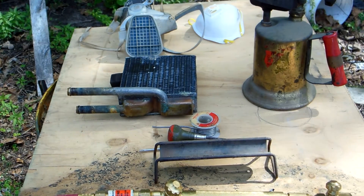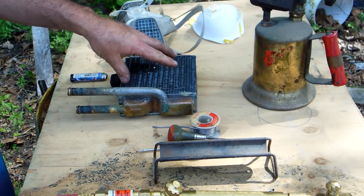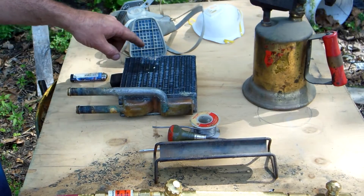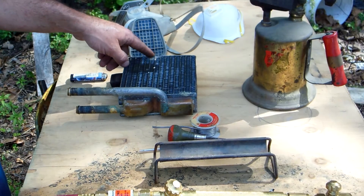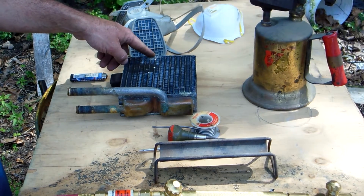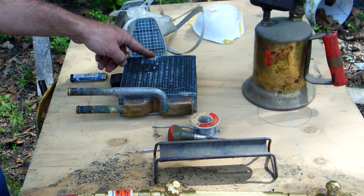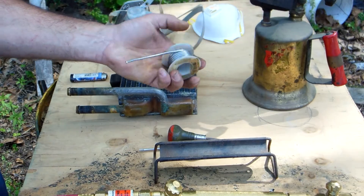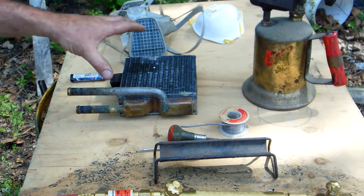I realize I forgot a few things, namely my lighter and some safety equipment. When you're soldering on anything old like this, you have to realize there are fumes. In this particular instance you're going to have lead fumes, old antifreeze and old stop-leak burning off — which creates fumes. Ethylene glycol is toxic. We've also got acid core solder, so you've got the acid flux fumes.